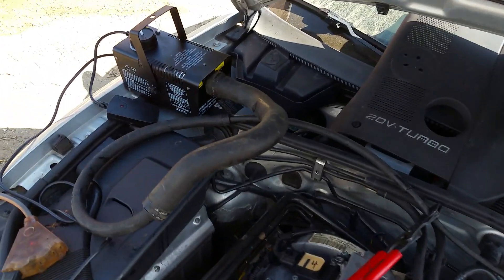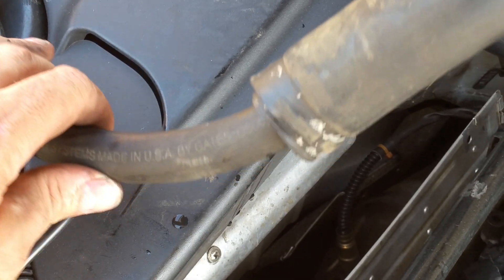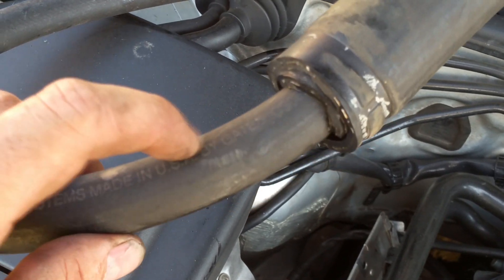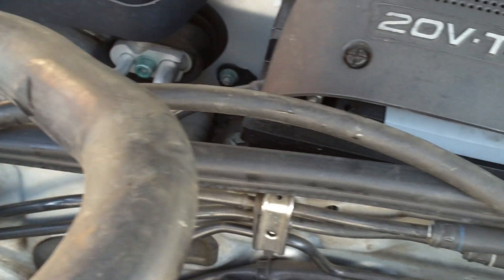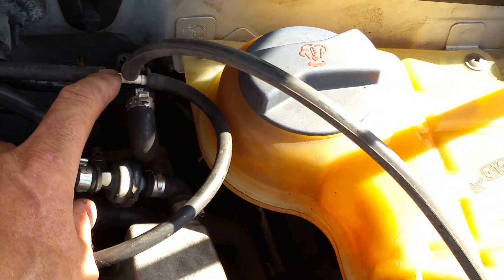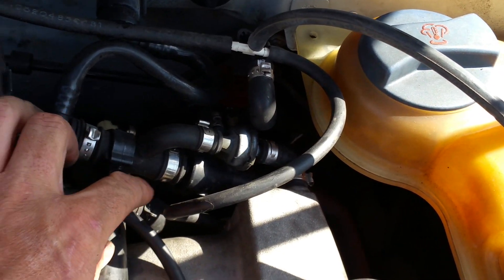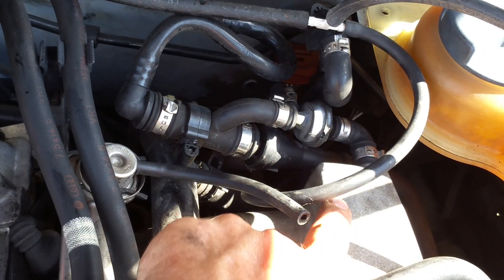Quick overview: smoke machine, radiator hose — it didn't fit in there, so I cut a little bit off of this radiator hose and wrapped it in there so this would fit snug enough to get a seal. Stuck that in there, found a hose — I think 3/16 hose — goes in there. One hose goes into the intake manifold, just the vacuum line I pulled off from the fuel rail regulator right there, goes from here right to the intake.